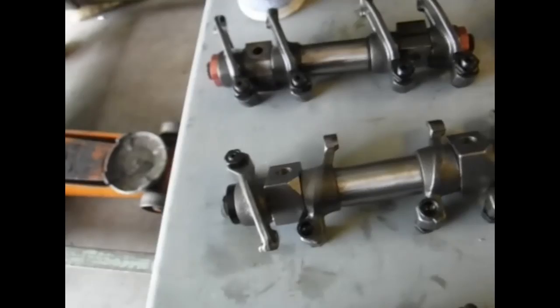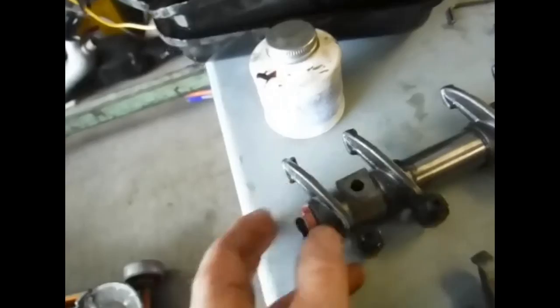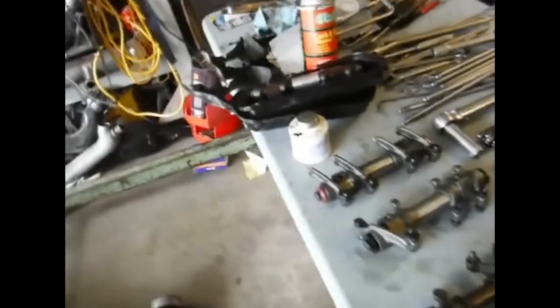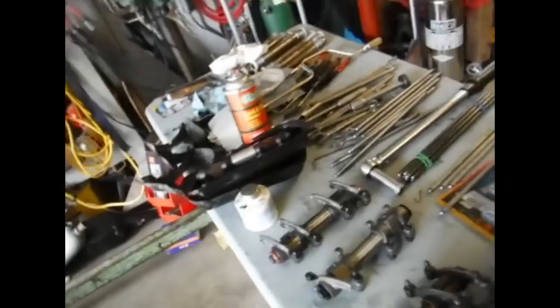This one advertises as a 1.25 but in reality is 1.3. Here's a Scat 1.4 that I had on my 2 liter - and I finally had failure with the studs. Was it because I didn't have the stock cam in it, or didn't have a ratio rocker cam designed for it? Who knows. I had no issues with coil bind, ran it for quite a few years and put quite a few miles on it with no issues, but its time came.